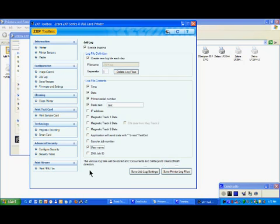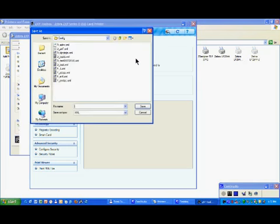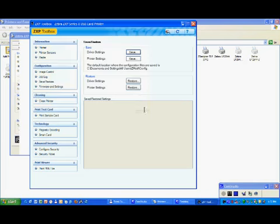Save and restore. For the driver and the printer settings, you can save them and they are going to be saved on this location. Very convenient to do, especially when you give a new printer to a customer. When everything is okay, just save both, give a name there, and then automatically you will have all the parameters from the driver and from the printer saved somewhere on the hard disk, here actually.